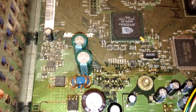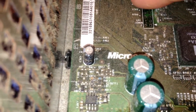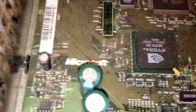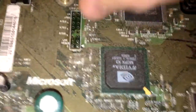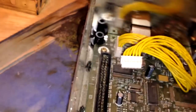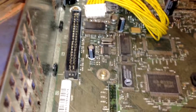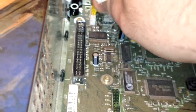This one is definitely a candidate for a TSOP mod. Matter of fact, it would be great if I had a mod chip — there's the LPC port right here, you just go right to it. It would be perfect. That's your regular IDE cable. There used to be a thing back in the day — people said you can switch these ATA-33 cables out for ATA-66 cables and get more throughput. I'm not 100% sure these boards even supported ATA-66, ATA-100, or ATA-133 for that matter.